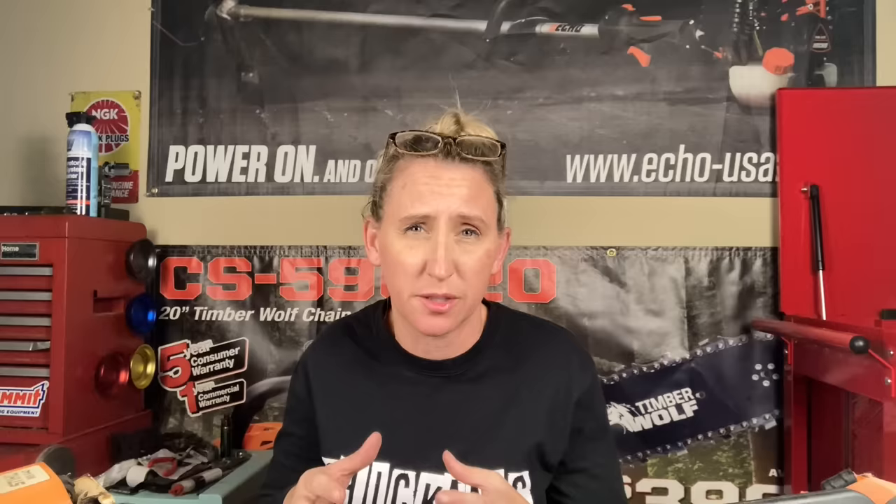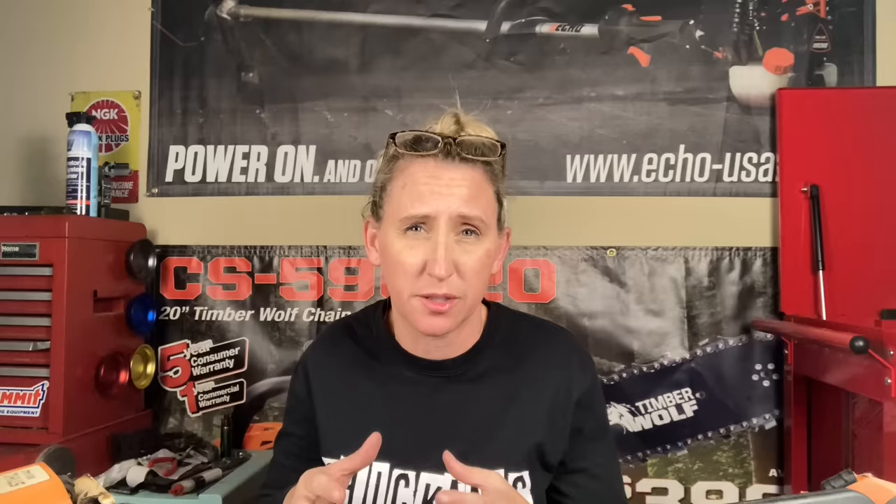So what are tank vents and why are they important? They put the right amount of pressure on the fuel — they let enough air vent out of the tank so that it's not pushing so much fuel into your carburetor that it's flooding the machine out. If your tank vent is missing, it will just be like an open gas cap and nothing's going to be pushing through to your carburetor. If your tank vent is clogged, it's going to never let that pressure out of your fuel tank and it's going to constantly push as much fuel into the carburetor as possible. The needle sometimes doesn't shut off well and it will flood out.